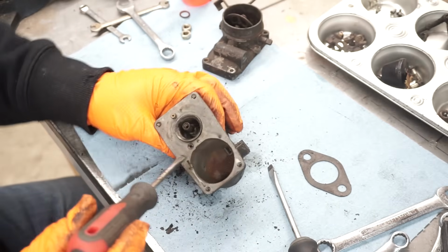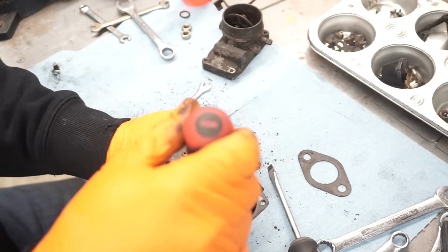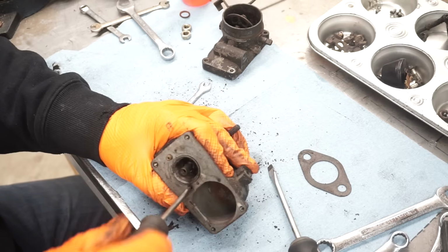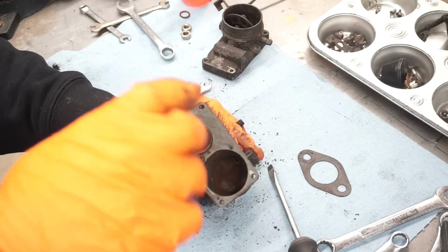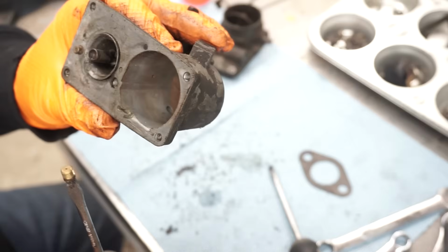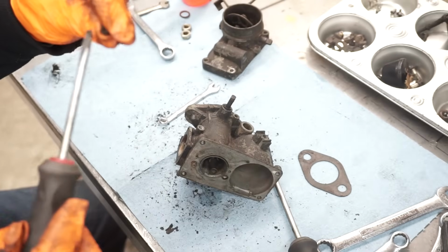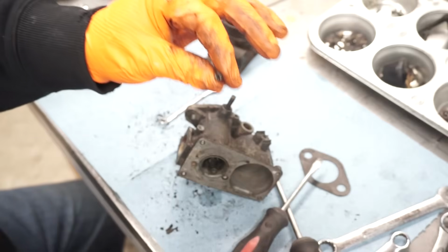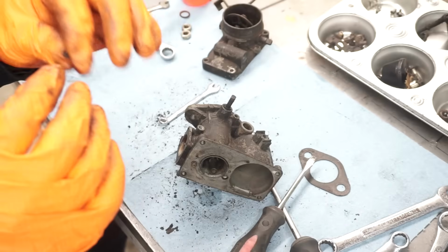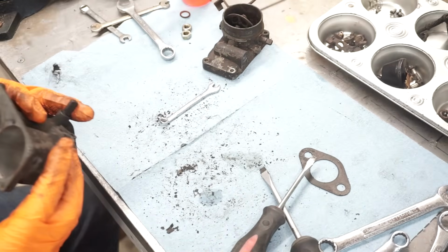And now there's this little jet that likes to strip out on you. But these have been coming out pretty good, so yeah, that's in there real easy. And that is another small little jet that's open. But again, just take brush wire and work it through there. And it's going in the ultrasonic cleaner with everything else, so it'll get cleaned up.